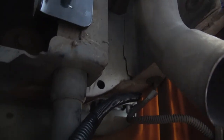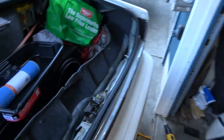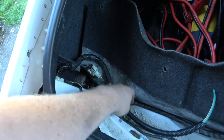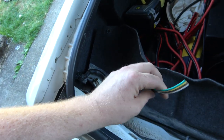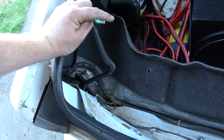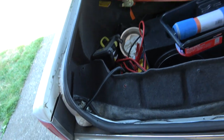It runs through here and goes up in there. Now I'm going to wire all that in. I'm going to trim this down just a little bit — I don't need a whole lot. I've got two or three extra wires in there. Yellow was the trailer brake, red was power, and then that orange with white was backup.